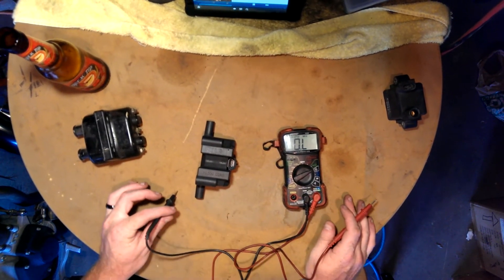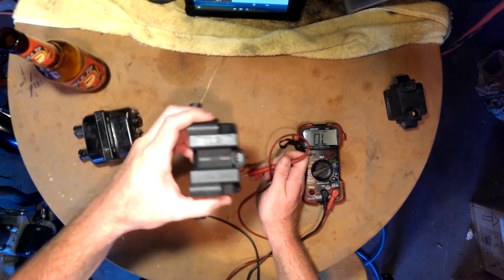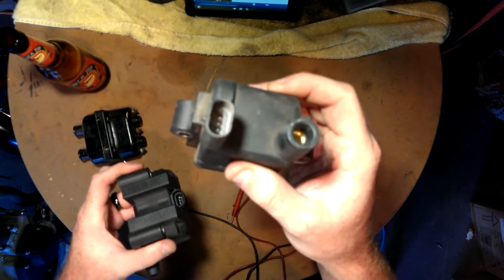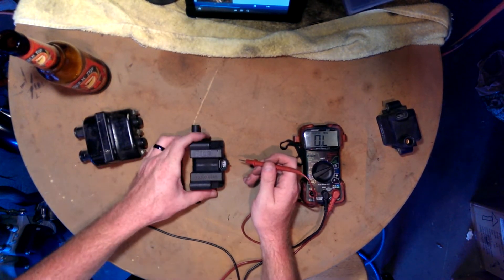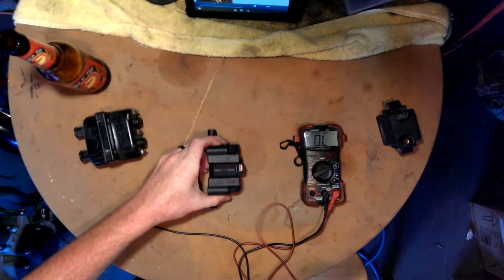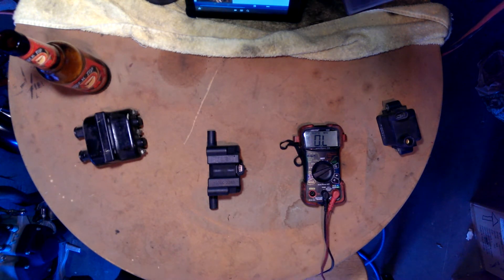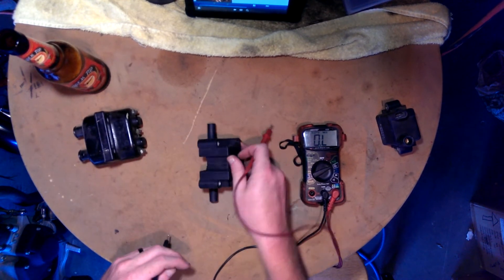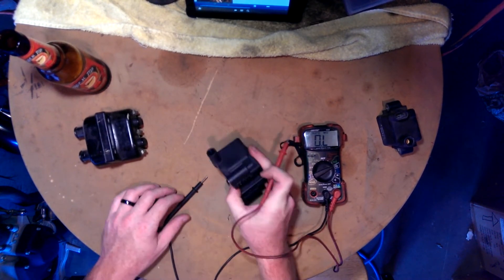On the XB coil — the table's all shaky — XB coil, you get 12 volts in the middle. Can you see those little prongs inside there? That's what I'm talking about. Blast coil — see those little prongs inside. XB coil, little prongs inside. The one in the middle is your constant or ignition — 12 volts, your positive 12 volts, your constant. That one's always hot when you turn on the ignition. The other two are your signal wires. Ground is achieved through the metal circles. Your ignition sends signal to the two outside plugs — fire, fire, fire — and it sends signal to the spark plug.